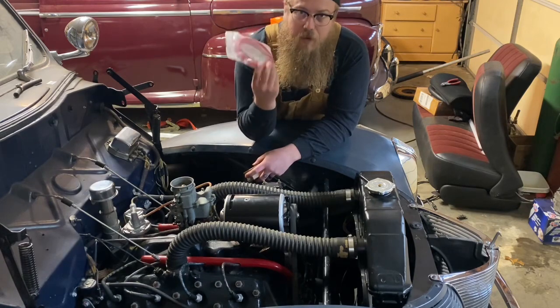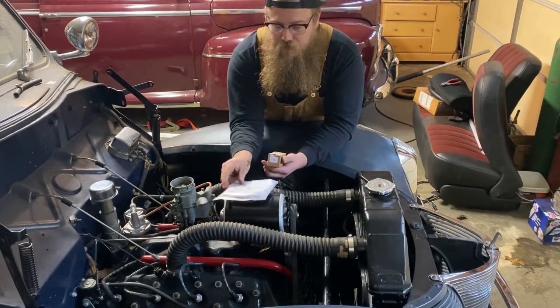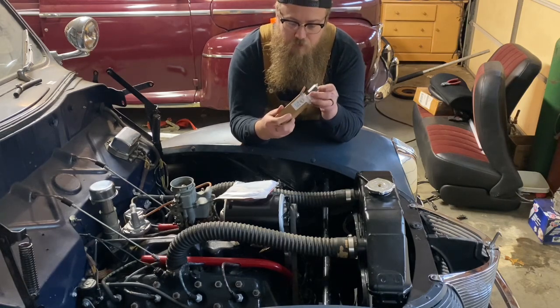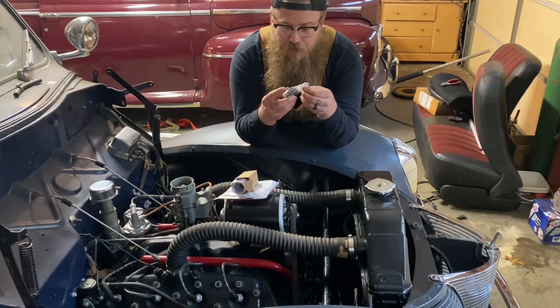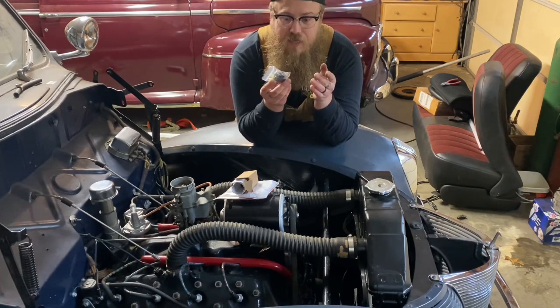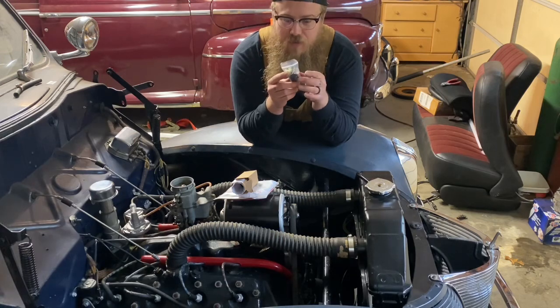Now this is more than just buying a wire. This wire also goes with this fuse. You need a fuse on your alternator. A lot of people don't realize that. There's this awesome fuse kit right here, 125 amps, and a replacement fuse you can put in your glove box in case something bad happens later on down the road.